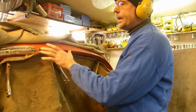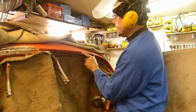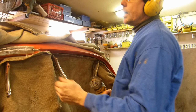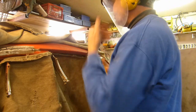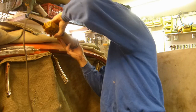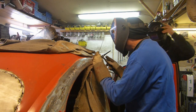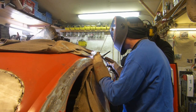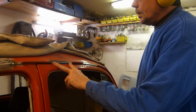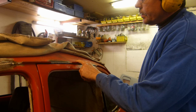I will always remove the gutter piece by piece, then weld a piece back, and then remove another piece of gutter. This serves to keep the roof in its position so that we do not risk too much deformation. You can see I already have the first section done. Left and right I weld the roof again, and now I will cut out the middle piece.